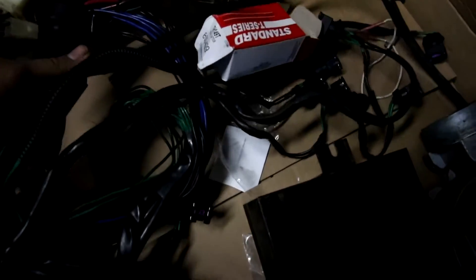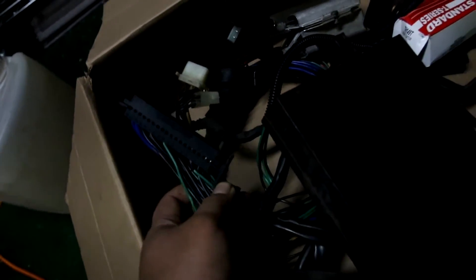I did this conversion kit because I had a problem with my car running. Basically there's a bad connection somewhere in the harness — I could wiggle it around and it would shut off the car, which is obviously a problem. It would do it sometimes when I'm driving, or even just shutting the door would freak it out enough to shut off. I tried different ECUs and it felt like it worked for a little bit, but the problem came back. So I decided the problem was within the harness.